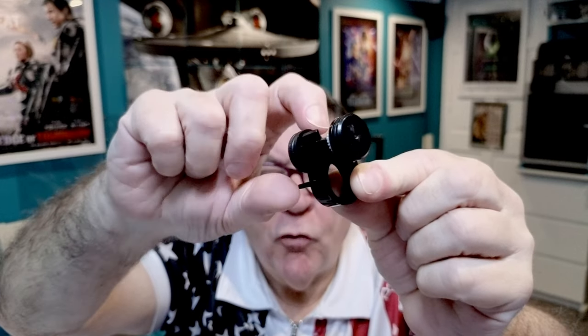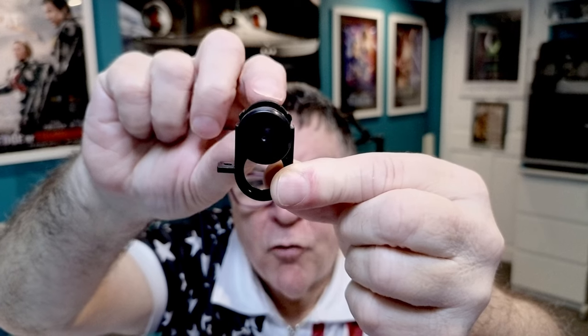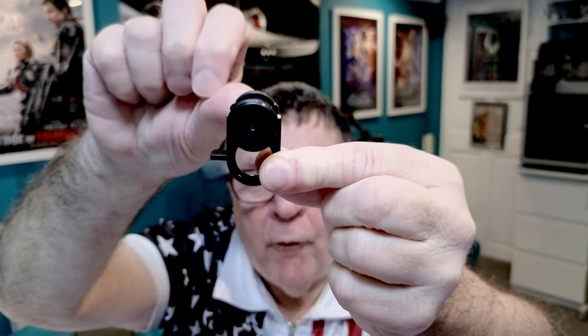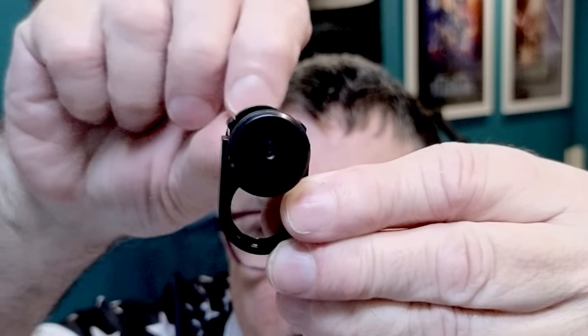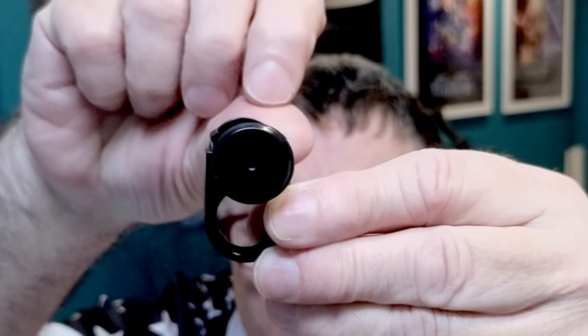So this is the method, like I said, they've chosen to drive them. Now if you look at this rubber o-ring here, it makes contact with them rollers, but it doesn't do it throughout its whole travel. As I turn it, you can see there's a raised bit, it comes up. It's a bit hard to see. I'll show you in more detail later with a replacement one they sent. And this one, you can probably see it better on that side. As it goes round, there is like an eccentric. So it touches the roller there and drives the spool. Then the spool stops and then it comes round and drives it. The reason they've chosen that is that when it's just in freewheel mode, when the motor isn't on, you can just sort of pull the rollers off and it will go onto the lower bit and not be in contact with that. So it enables it to freewheel.